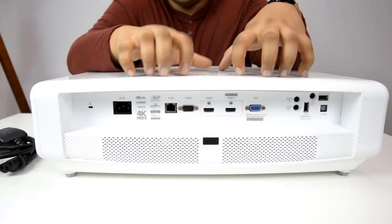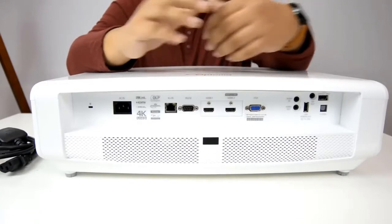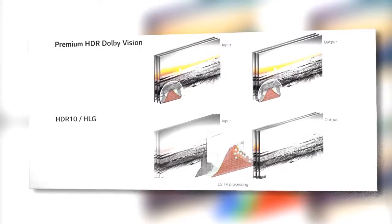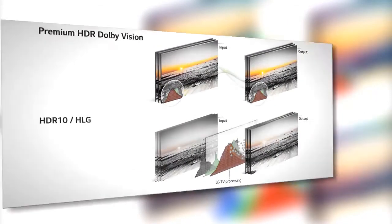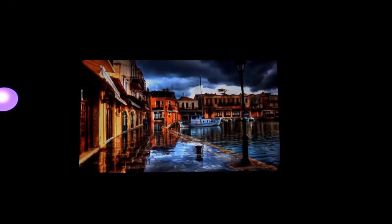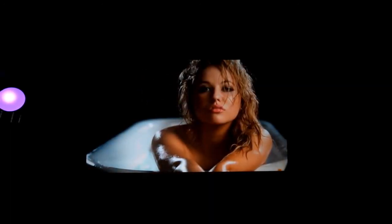The UHD60 also supports HDR10, which is always a good thing, and for those of you that don't know what HDR10 is, it's basically the HDR standard. We don't have any support for some fancy hybrid log gamma or Dolby Vision HDR formats, so that's not really to be expected again at this price point. The UHD60 can also convert SDR content to HDR, and I must admit it does a pretty good job. There's no jittery movements in the image while it's processing non-HDR content. The image wasn't overly manipulated and colours weren't processed to look overly harsh.